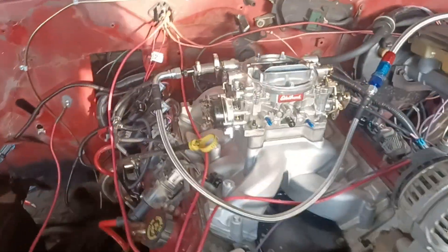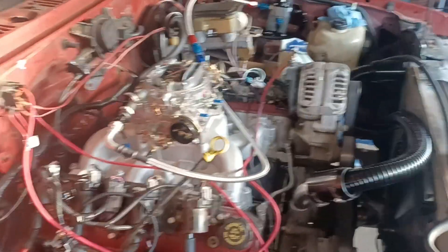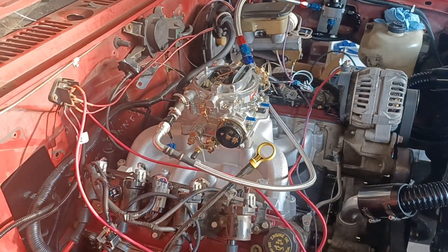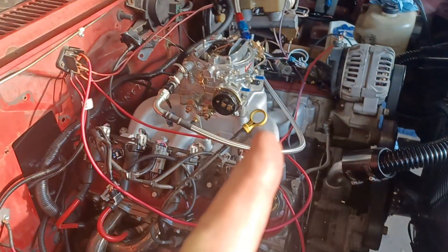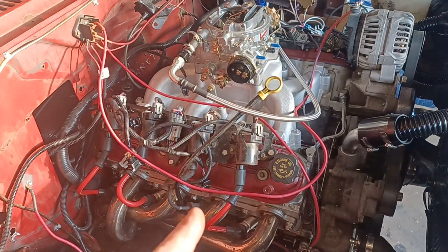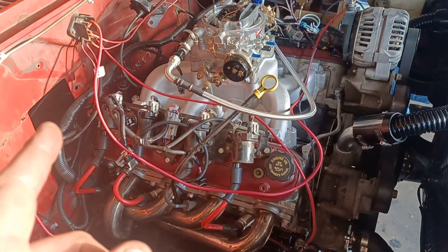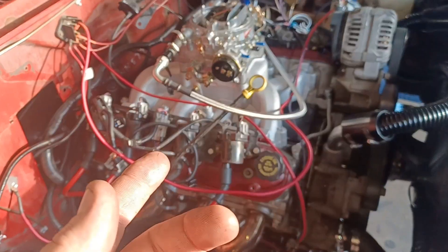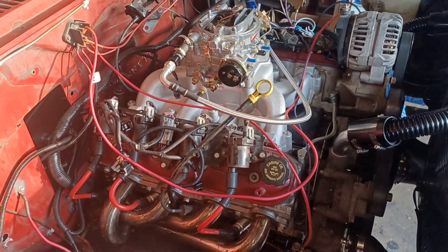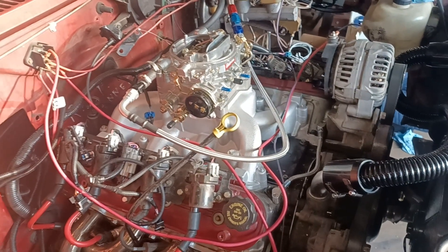She's quite snappy! He eliminated all the injector codes, eliminated the MAP sensor, and put a really nice timing map in it just based on RPM. I think it starts out at 12 degrees and goes incrementally up to 34 total, or 32 total — I really have to look at it.